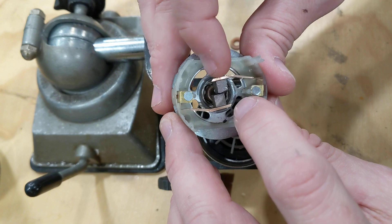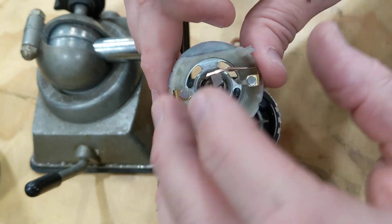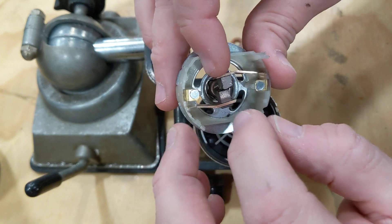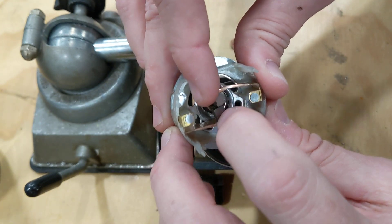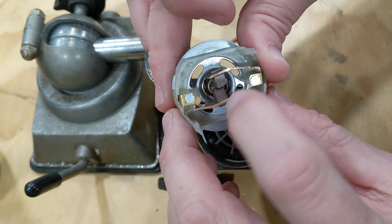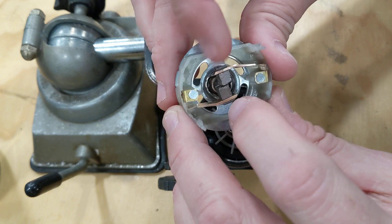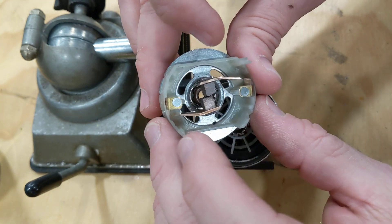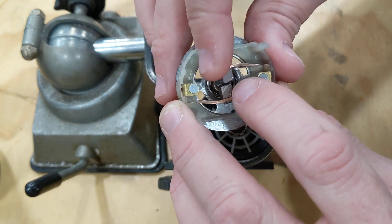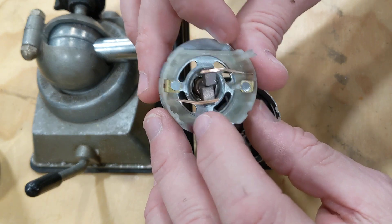You don't want to do a lot of stopping. Every time you stop, the motor jerks and that causes it to make a larger spark. Eventually those sparks will cause the motor brushes to chip and even break off, and that's pretty much a permanent total for the motor. Also, running in reverse will wear the motor brushes in the wrong direction. So you want to always go forward at a low speed, stopping as little as safely possible, as it indicates in the instructions.